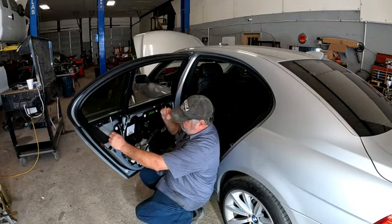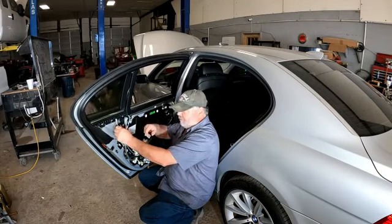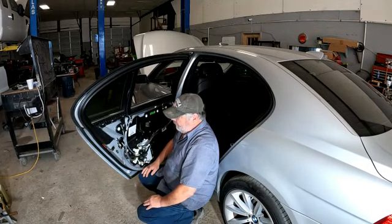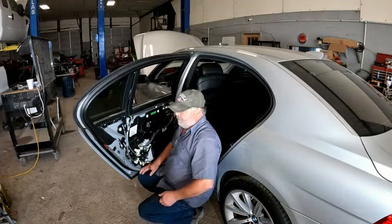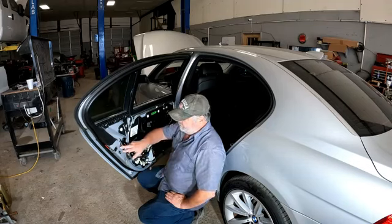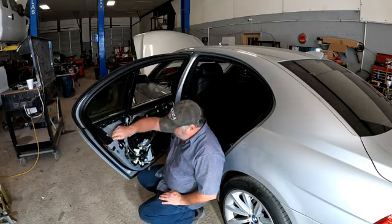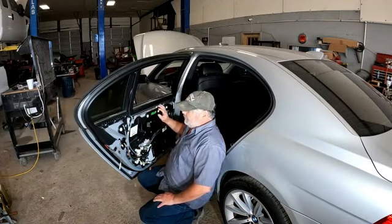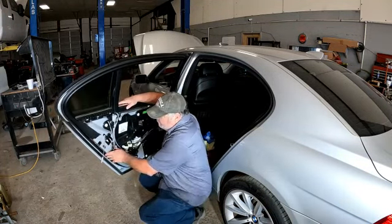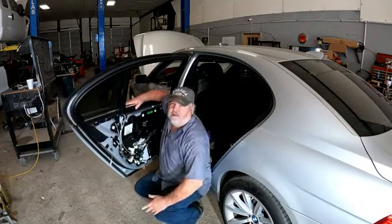Before I even took this apart while diagnosing it, you'd hit the remote button for lock and unlock and I'd watch it go up and down, so I know that was working. I've talked to the customer — I'm not going to replace it. I'm not going to spend $400-plus for something I don't know for sure is bad. So I'm going to lubricate this up real good, put some lubrication all in here, work it back and forth, and give it back to the customer. See if it'll last a while — if not, then we might go to that. But I'm not guessing on it. Anyway, it is what it is — thanks for watching.